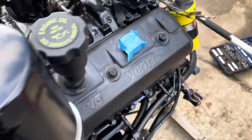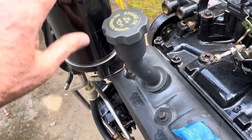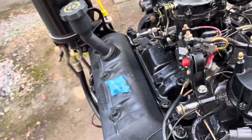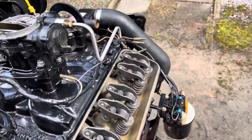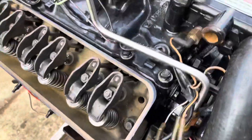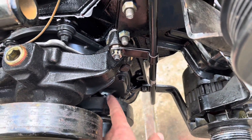So there's another way to do that. Because I've got this remote oil filter, I can't get this out. I've already got this thing primed with oil — I don't want to take this filter back off because it's full of oil and I can't twist this out with that in the way. So I really can't get to number one. So the alternative, or another method, is look at number four. Well, this is cylinder number four. This valve cover was easy to remove because there's nothing in the way yet. So I took it off and I'm looking at number four. As I rotate this engine around and the timing mark is coming up and the line is coming up on the top dead center timing mark.